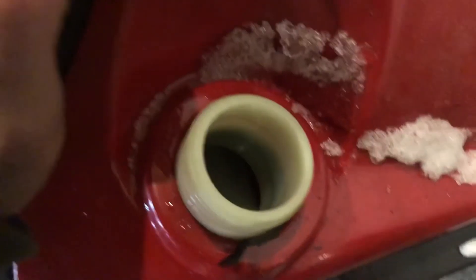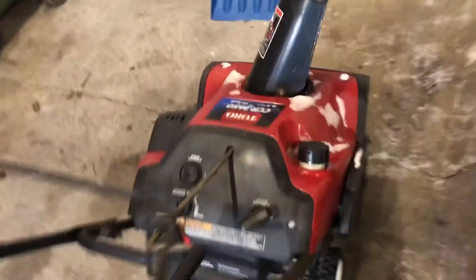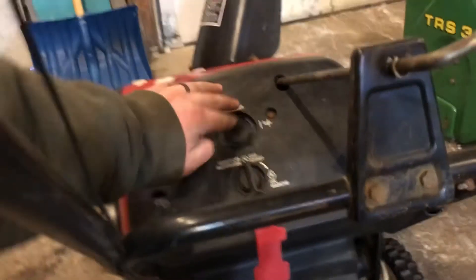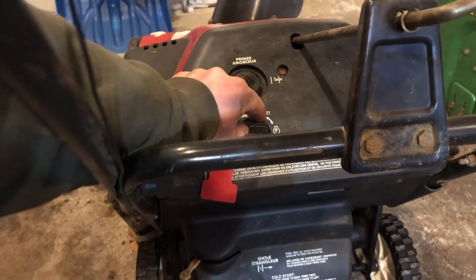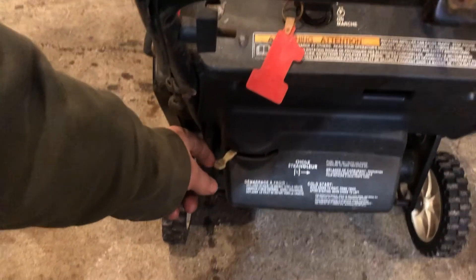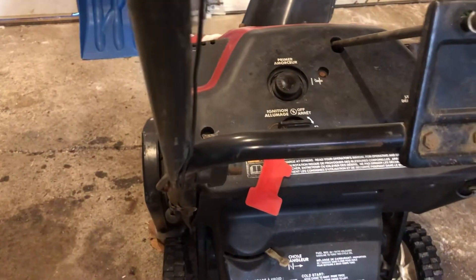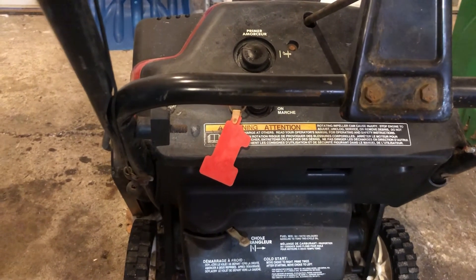Anyhow, we want to make sure that we have plenty of gas, and I know this is fresh and mixed with oil properly. There are a few fewer controls over here. We do have a primer ball, so we're going to give it a few pumps — that gets some gas to the carburetor and engine. We're turning on the ignition, which will allow a spark to form at the spark plug. And we have a choke lever, so we're going to flip the choke on. I don't see a throttle or a shutoff for the gas — this snowblower doesn't have one; the throttle is automatic and the gas is always on.